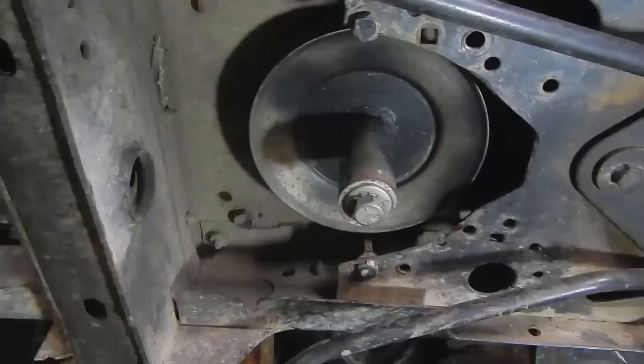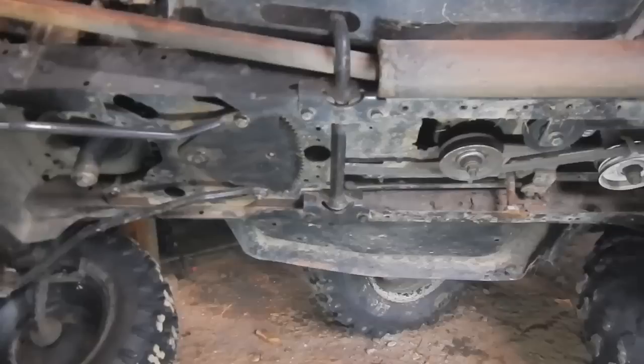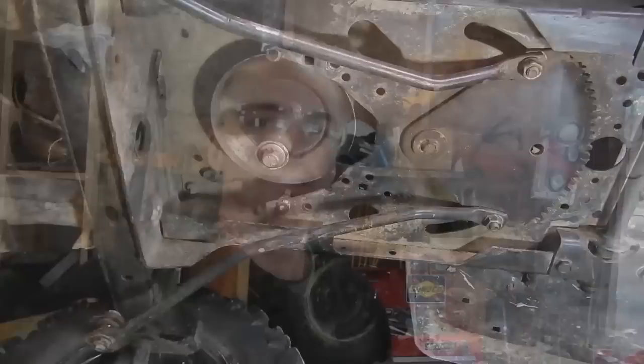Actually the outside dimension of this pulley is the same as my new pulley, but the well on the inside where the V-belt actually sits is significantly different. I'll show you what I mean once I get it removed. But I've got a lot of work to do before I can start swapping the front pulley, so I've got to get this belt off and get the new one pretty much in place, and then I can swap that front pulley out.